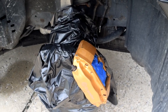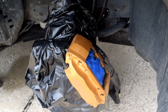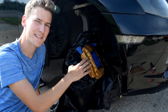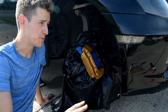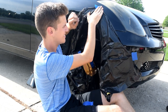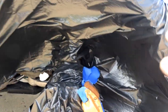Now I'm using some blue painter's tape to mask off anything I don't want paint on. Keep in mind everything you're spraying is going to end up red — or whatever color you choose — so make sure you mask everything off, including the bleeder caps. Now we have our caliper masked how we like it and it's clean, so we're ready for priming. But first we need to tape up around the garbage bag because we really do not want any overspray on this paint.